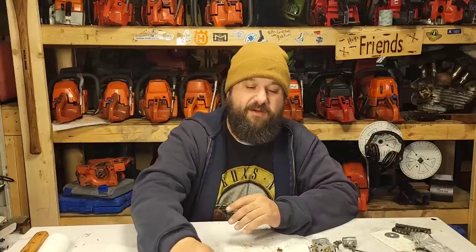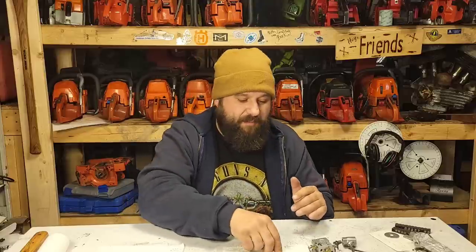If you've built a ported saw and think you need a bigger carburetor — if you are putting a carburetor with an impulse line off of another saw, if your stroke isn't the same your bore-stroke isn't the same, sometimes you can get into a little trouble. Those short-stroke 266s do not like an impulse line carb unless it's the 270 or the Jonsered 670 version. Most of the impulse-lined carburetors — like a 390 or 372 carb — in my experience on 266 builds they don't get enough impulse, which makes them kind of erratic. You're better off to just go with a bigger Tillotson in my opinion.